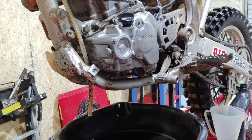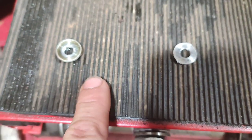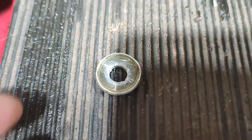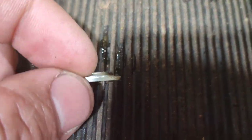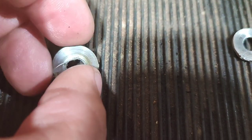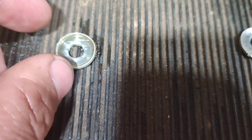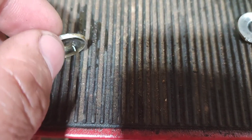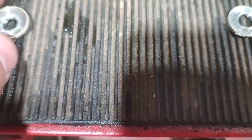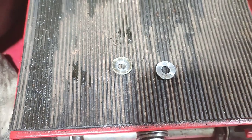I'm going to put the cover back on and put the drain bolts back in. Here are the crush washers — you can see this one is damaged and this one is completely deformed. These are made to crush and help seal it, so you don't want to put these back in. Make sure you get new ones. This one was stuck in there. Do it right — put new ones in. So I've got new washers going in. Let's put them back in.